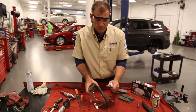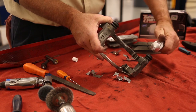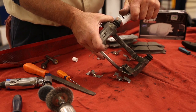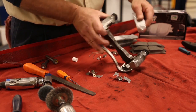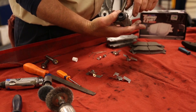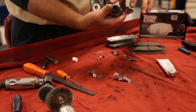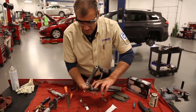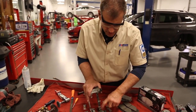Take some silicone lubricant or high-temperature molybdenum grease — it must be a high-temperature grease because we are dealing with severe temperatures. Put a dab right where the abutment clips or guide plates are going to go, just to prevent any future rusting. Apply a little lubricant here and so forth.